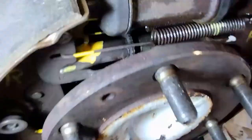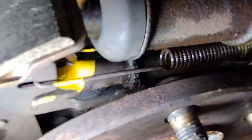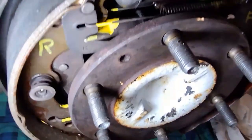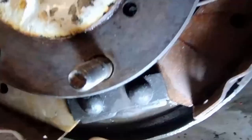We've got an adjuster arm going from there to there, and that's got a cog in there. There's an arm going down and across to the inside that turns that sprocket-looking thing and tightens the shoes up to the required tension. There's a spring down here and the shoes on the bottom rest on this retainer.